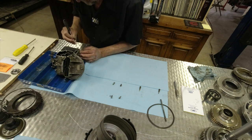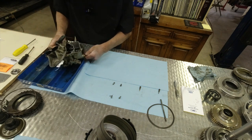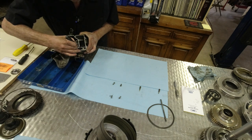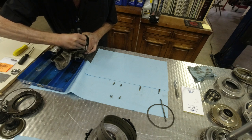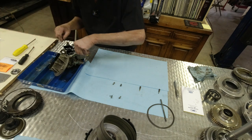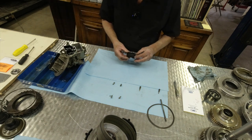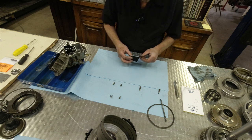Let me get my screwdriver here. I'm going to go ahead and pop out the, let me show you here. This carburetor will run without the top even on it. But what I want to show you, there's a clip. Just push, probably both sides, and pull it up. I can already tell you, it sure feels like, oh yeah, that float is saturated. Kind of what we thought, one of the things it could have been.